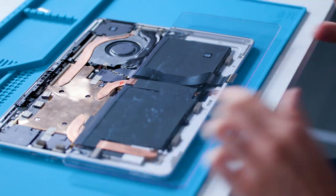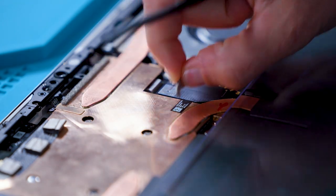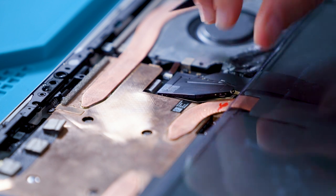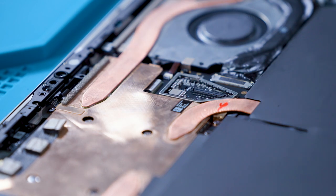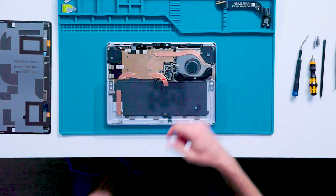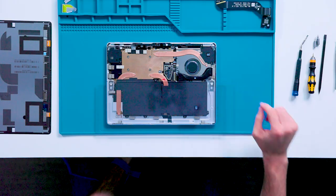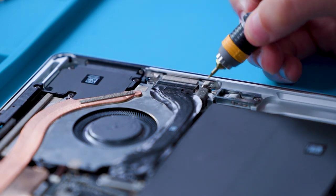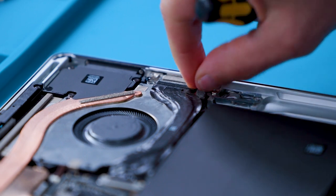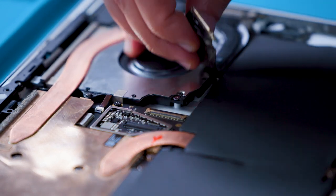We'll place the battery cover while we work on internal components. We'll use the spudger to remove the shielding lid and conductive tape to remove the other end of the display cable. Next, we will remove the surface connect cable. Using a spudger, disengage the latch to release the left end of the cable. The surface connect cable is now only attached by screws and an adhesive strip. Remove the two screws on the right end of the cable using a 3IP driver. Note that there are magnets on this connector and the screws might become attached to them during removal. To remove the cable, hold the retention latch and pull up. Keep in mind that there is adhesive holding the cable against the fan.